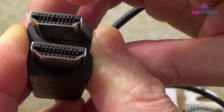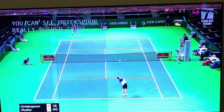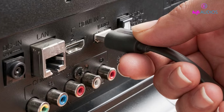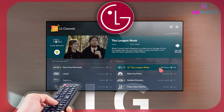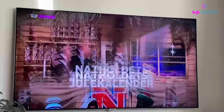that you know works. To figure out if the flickering is caused by something connected to the TV, unplug all HDMI cables and any other input devices. Then, just open the TV menu using your remote. If the menu itself is flickering, even with nothing plugged in, that means the issue is likely with the TV's panel, not anything you had connected.